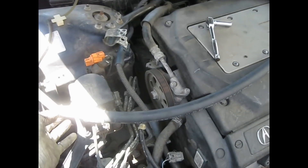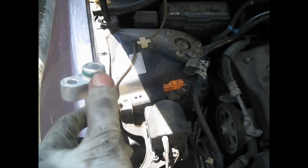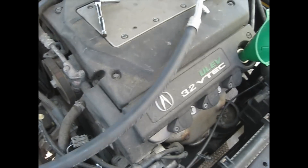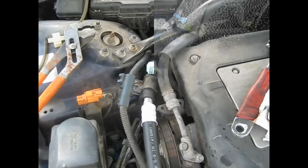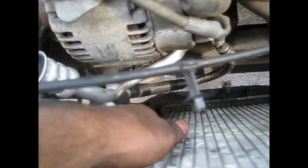This is the line here. You just get your new one, put new O-rings on both sides, put some AC oil — PAG oil or mineral oil — and just put it back in. Fish it through the same way, make it nice and snug, not too tight. So I put back the low pressure AC line, the brand new one. I put a piece of rubber here so it won't rub on the other AC line, the discharge line.